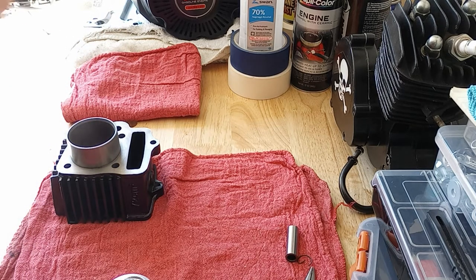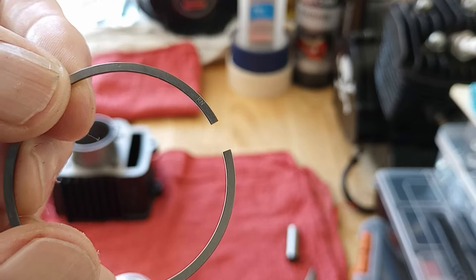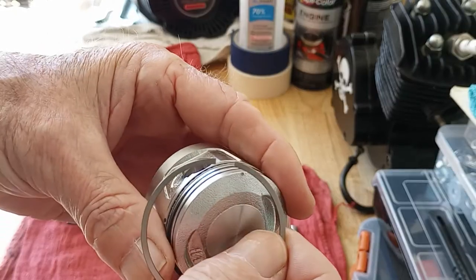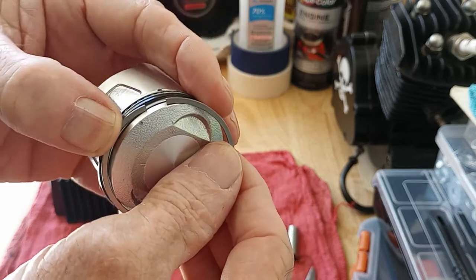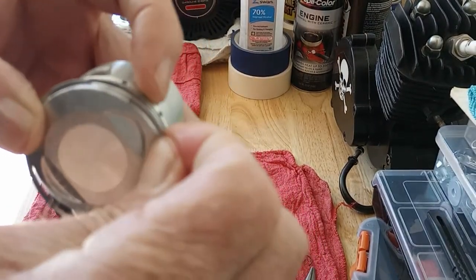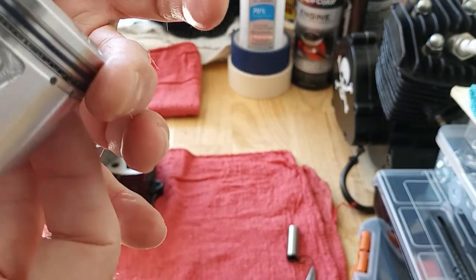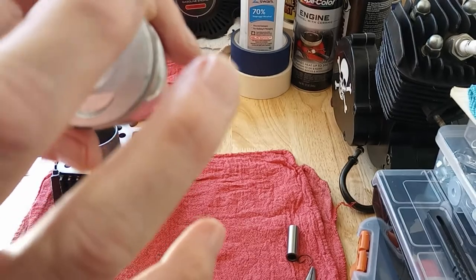Make sure — let me see if that'll focus. There it is: R-N, see it? Okay, that goes to the top. Hook one end in the groove like so, stretch the ring without over-stretching it and without scratching the piston, and get it on there. So that's how you do that — you clock the rings at 10, 2, and 6, so the gaps are at separate places when they're installed.